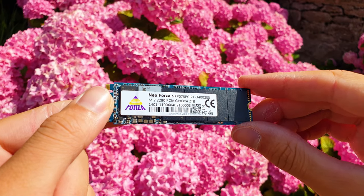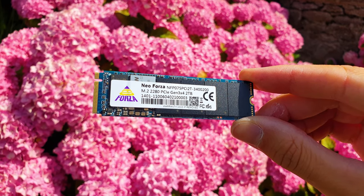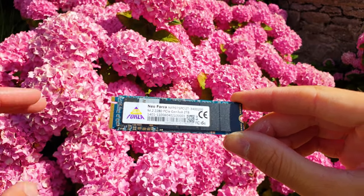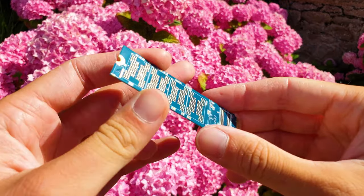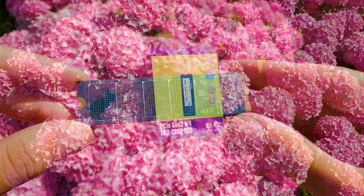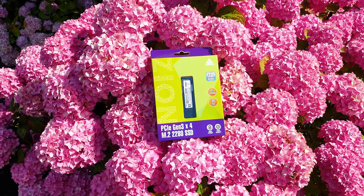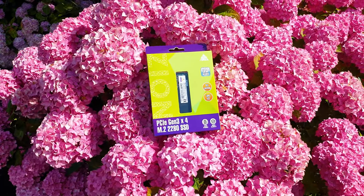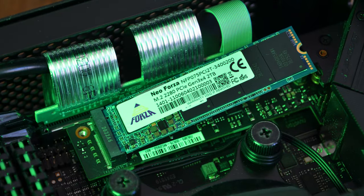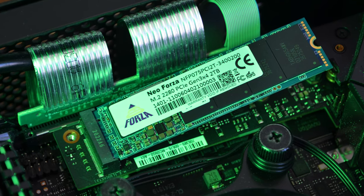Well, there you have it. Plain and simple, this Neo Forza Esports 2 TB shapes up to be one of the best drives in the Gen 3 X4 generation you can grab right now, as it ticks all the right boxes. If you have a board with both a Gen 3 and Gen 4 port you can mix and match. It beats its competition in this price bracket, with the key difference being TLC cells — giving you higher endurance ratings and native sustained speeds over QLC alternatives. Just keep an eye out whenever it's back in stock, give it minimal airflow, and you're golden. Thanks for watching, see you in the next one. Alex out.